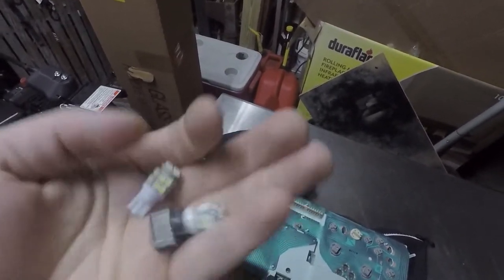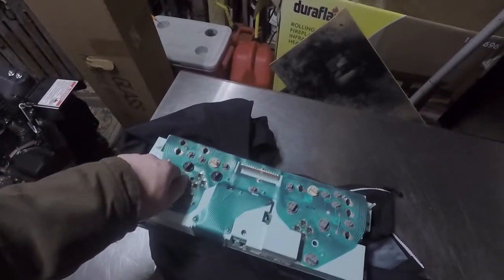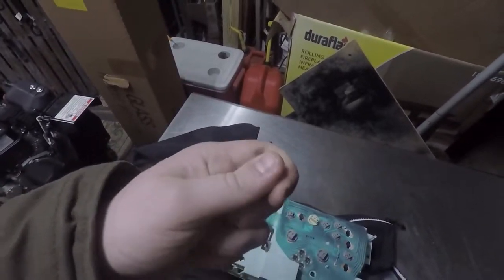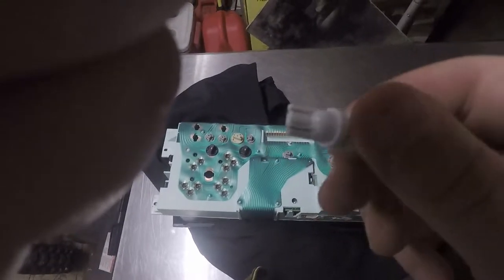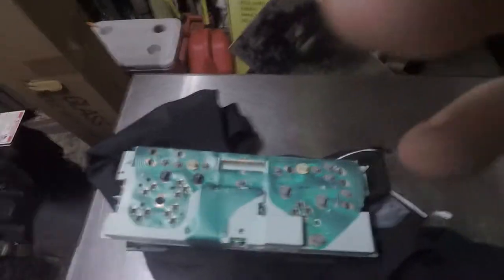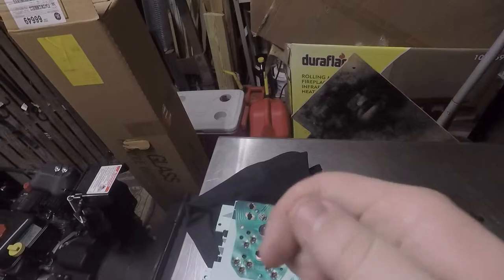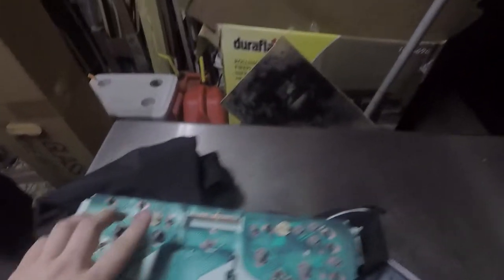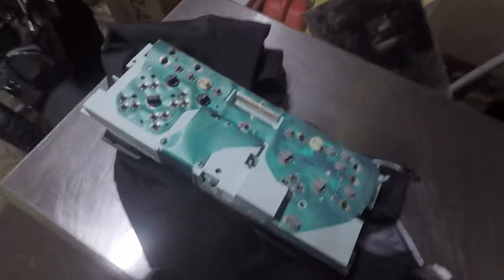You don't know which way is the correct way to put these in until you put them in. Put the black connectors back into your dash and find out if it lights up or not — if it lights up you did it right, if not switch it around. I'm obviously gonna do it off camera because they just pull out. They're just socketed in there. So they just push in — I'm gonna put this back in. I'm gonna do that for all of these, the two up here and then these three, and see how many of them light up. Whichever ones don't, I'll swap around. I'll be back when they are all lit up.